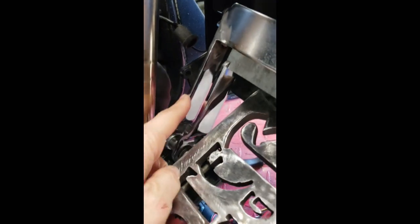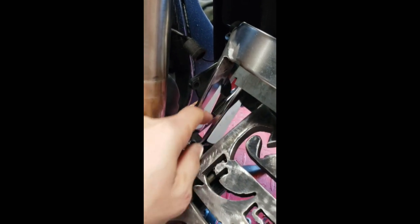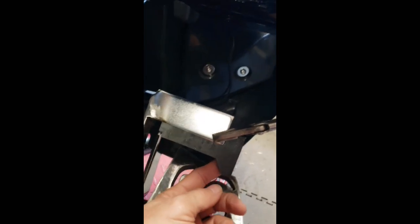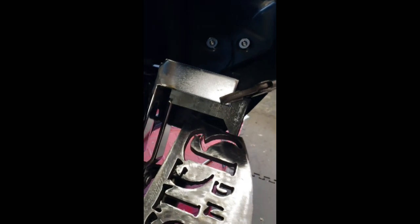I've decided what I'm going to do for these brake levers. I took a stock brake lever from this bike — a Roadstar — and one from a Royal Star. Actually this was the Royal Star foot pedal because it's bigger than the Roadstar one. I cut the pieces off the back, welded it straight to the arm, and I'm creating a second one down below. I'm lining it up how I want it and making sure it'll actually clear the footboard. I'm going to shape this a little bit better — round this out, smooth it. I think I'm going to cut the face so they are actually flush across the face, but it'll be two different pedals.